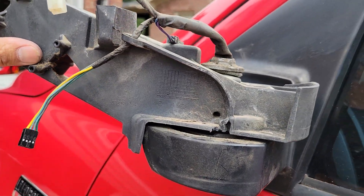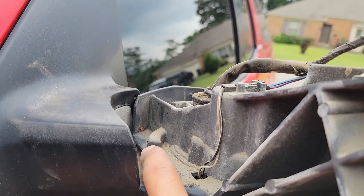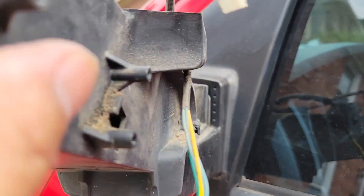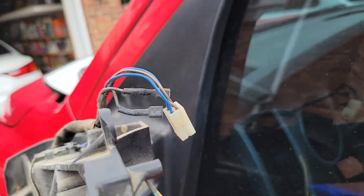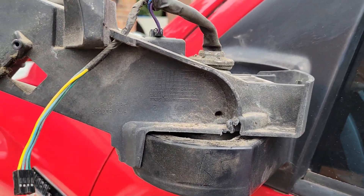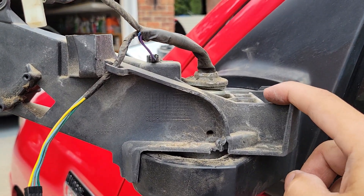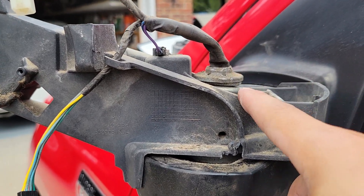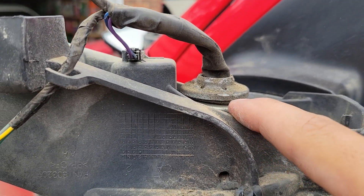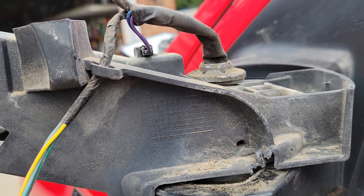You can push it out and there's a stopper right here that keeps it from going any further. I didn't realize it while I was manhandling it and I broke this part on this side where it closes and stops — so now it just goes all the way. Anyway, if you want to disassemble it and fix whatever you need to fix — I think the only thing holding this part on to the bottom part is this little cap. It looks like it's pressed on, and if you pry it off the spring should pop out — this cap holds the spring together and applies tension to the whole assembly.